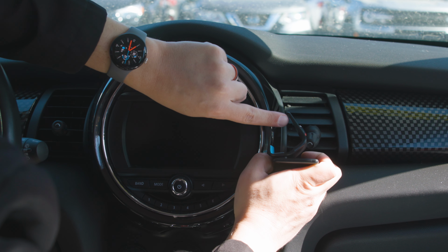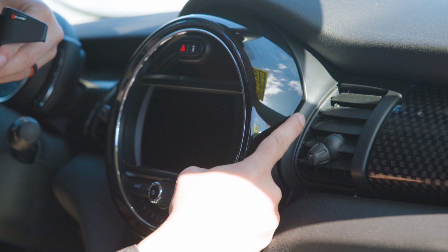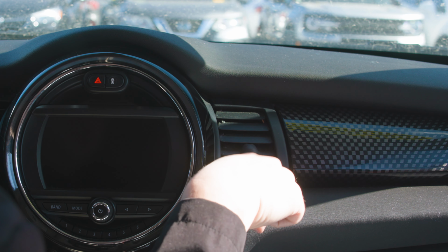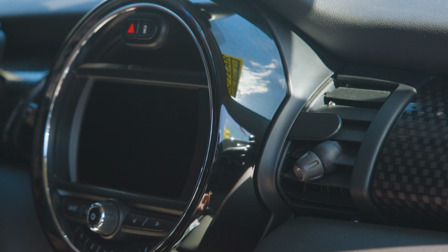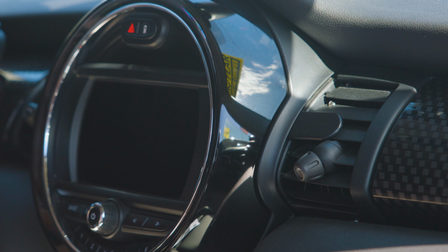The J-shaped lip goes into the second seat, which is between the inner part of the vent and this outer matte black piece right here. To start off, you'll want to angle your vent louvers all the way down. Don't worry, we can move them back after we're done. Then we're going to take the included gap opener and insert it into the seam next to the vent. And you kind of just want to line it up with the top of the vent knob right there.